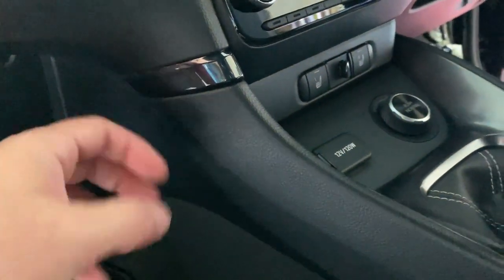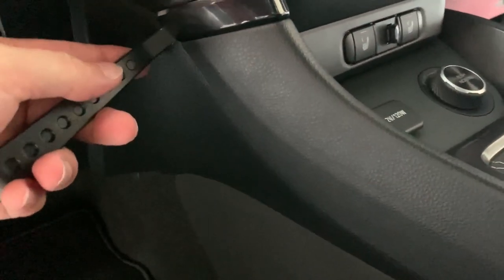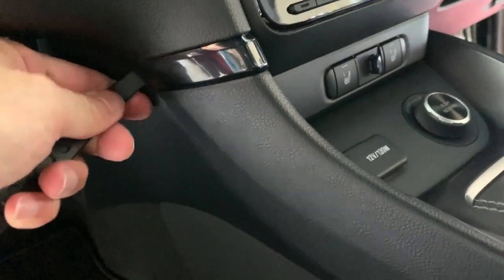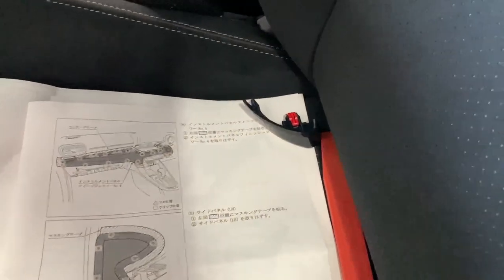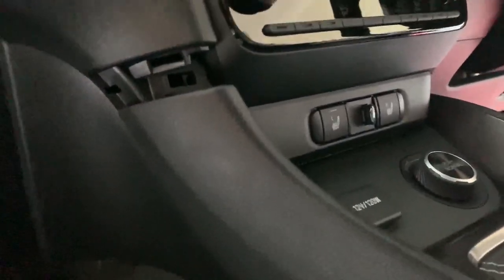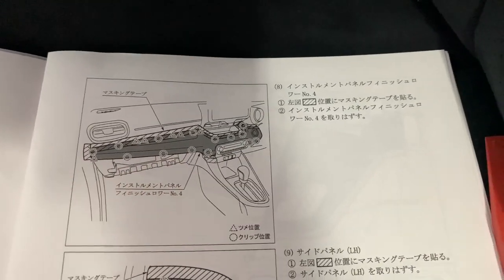This little piece is next — I'm going to use a trusty trim removal tool. Straight in and there we go. That's what's behind there. The next step is the difficult one — it's the entire center dash bit. I think this might have to use two hands because it's a significant piece. I'm not entirely sure what's going to happen when I get to the push button start, whether it's going to stay in or come out. There'll be a wire attached to it. The diagram shows how many different clips there are.